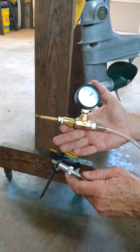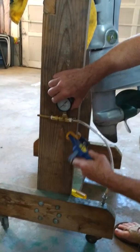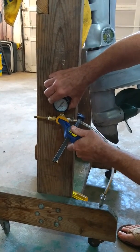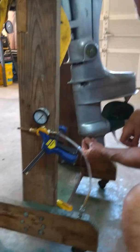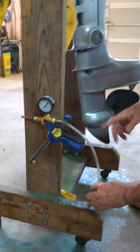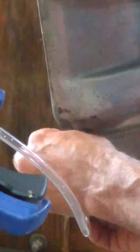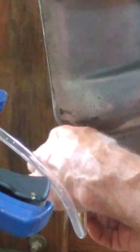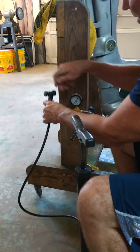I came up with this little apparatus — turns out it works pretty good, little trial and error. I got two motors here: one needs a seal kit and one does not. You want to test between six and nine pounds. The nice thing with this, I made it so you can hook a bicycle pump up to it and really control the pressure that you apply, so you don't over-pressure it.